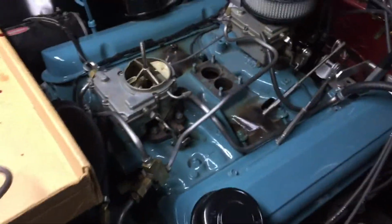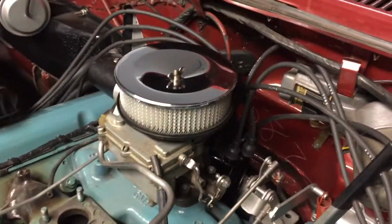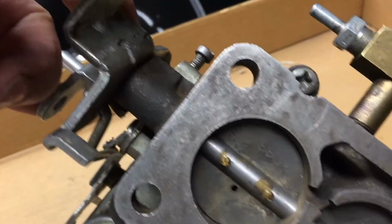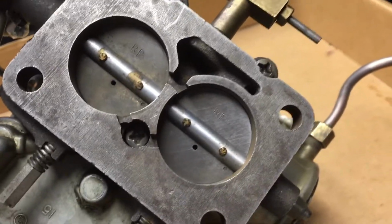Confident now that I've got all the issues out of this carburetor, the center carburetor. Well, like I said, I'll go ahead and pull these outer carburetors off, make sure I don't have any vacuum leaks. You can see there's a really good seal all around these butterflies. It's good contact on the bore. I need to make sure I've got the same thing on these other two carburetors.